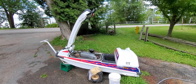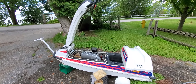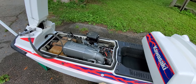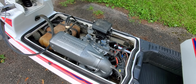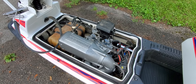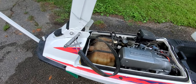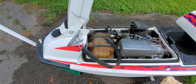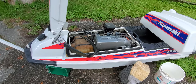I did believe, if I remember correctly from six years ago, I stored it correctly. I put some engine spray into the cylinders. I just pulled the plugs and checked and they look nice and oily. The gas does not smell bad. I did put probably a double or triple dose of stabilizer in it, and I ran antifreeze through the cooling lines.